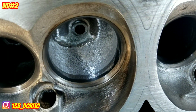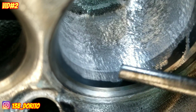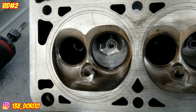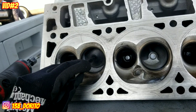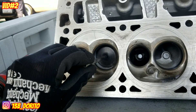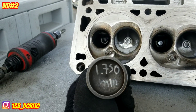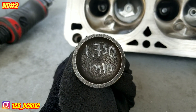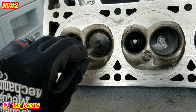See the difference between the aluminum and the metal — see the color difference. You can see where I removed material all the way down on the valve seat. Right half of the valve seat, perfect sizing right here. If you go to a machine shop and try to find the valve, they have a bunch that are trash — just make sure to take this measurement.